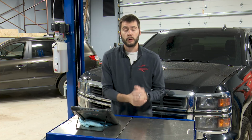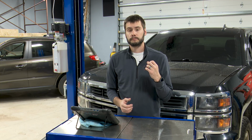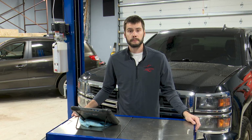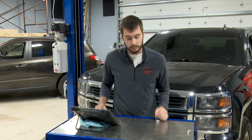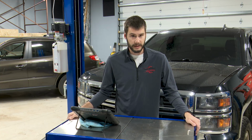So I hope you enjoyed the video. I hope this helps you when you're installing a high pressure fuel pump. Things to note: get rid of the pressure in the high pressure fuel system before you go trying to disassemble it. You don't want to have 1,000 PSI in that fuel rail when you try to disassemble it. Another thing you want to do is make sure that cylinder 1 is on top dead center of the exhaust stroke. I showed you guys how to do that. And then pro tip, when you're reinstalling the intake, make sure to put that stupid little piece of foam sound insulator stuff back on. Otherwise, you'll have to remove the intake and do it again. Ask me how I know.